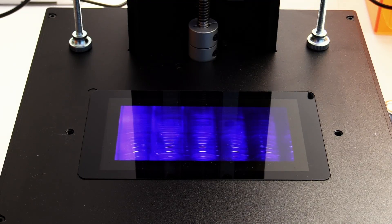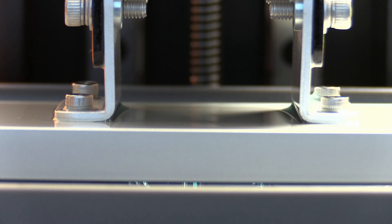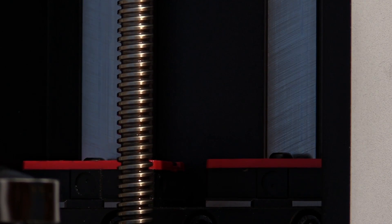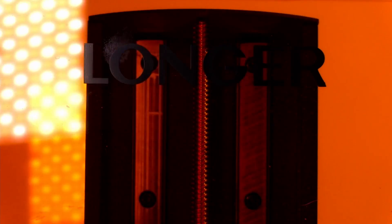This printer has a monochromatic screen to block the ultraviolet light from the light source, which means that the machine is very fast. Mono screens are much more capable of blocking ultraviolet light compared to RGB screens, and this means that the ultraviolet light source can have much more power, which speeds up the curing time of the resin a lot. Where normal resin 3D printers have a cure time per layer of 8 seconds, this printer only needs 2 seconds per layer, so this printer is 4 times faster than, let's say, my Elegoo Mars printer.